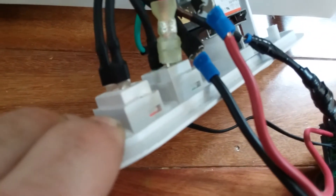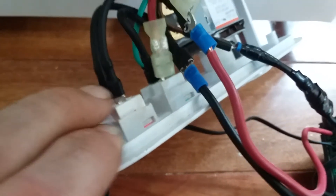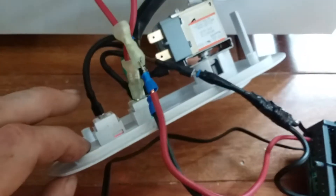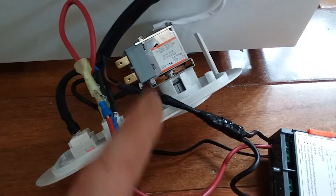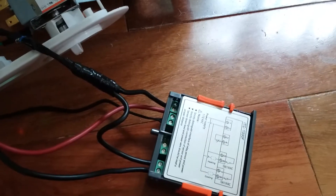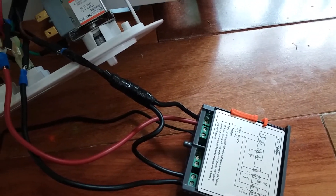Your neutral is not always going to be your white wire, but if you know a little about electronics: power has to go in one side of a light and come out neutral on the other side — that's how you complete the circuit. So once you find out what's hot, the other wire is your neutral. Mark on a little piece of paper what color your refrigerator uses for power and neutral. After you find that out it's easy peasy — hook it all up and you're good to go. If you have any questions, just ask. Hope this helps.